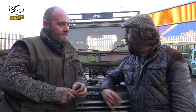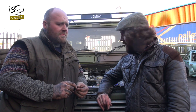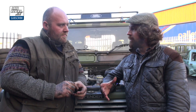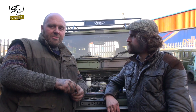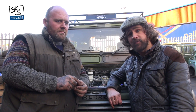How long do you reckon these pipes and that will last now? The pipes should last quite a while — as long as you keep them clean and they don't get contaminated, they should last the life of the vehicle. And Evans say the same with the coolant as well. We've gone through the prep fluid process and put the waterless coolant in, run the engine up to temperature. Is there anything we need to keep an eye on? Yeah — take it out for a good run. Once it's run up to temperature and the thermostat's open, get back home and check the level when it's cool, not when it's warm. Fingers crossed — we should be set for the rest of this engine's life.